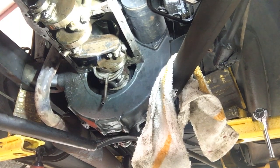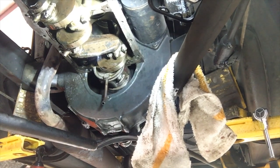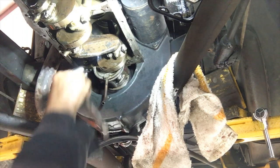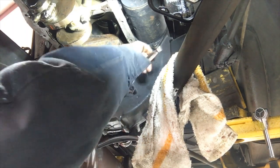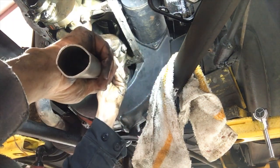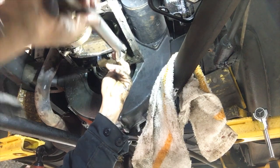Okay, see it's locked up now — I can't turn it. So I'm going to pull it back down, put one shim in, and we'll have this bearing done. We'll do the same thing with the remaining middle and front bearings.